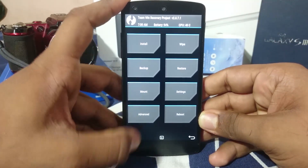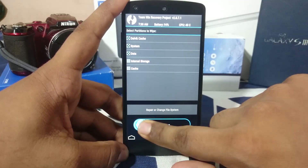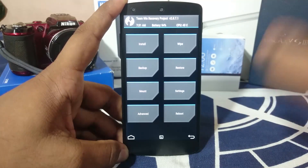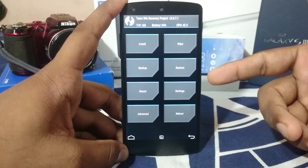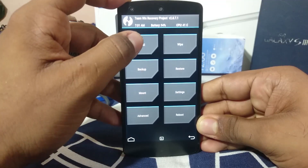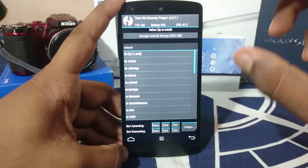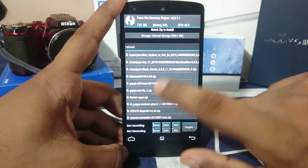I'm going to wipe because I'm showing you how to flash a new ROM — swipe to wipe. Everything is now wiped and the phone doesn't even have a ROM right now. Do not reboot because it will go into a boot loop since there's no ROM to fire up. Now, flashing the ROM is really simple — just go to the location where you copied the files. I copied it to internal storage directly.